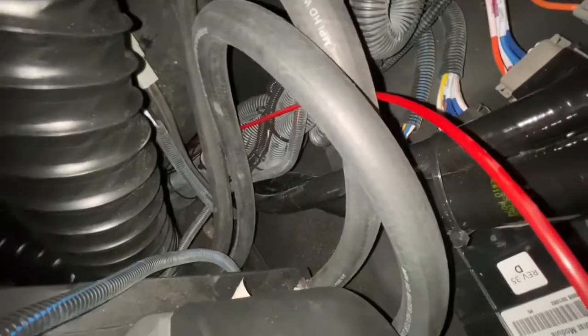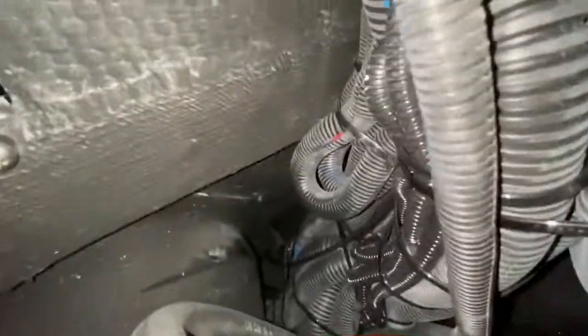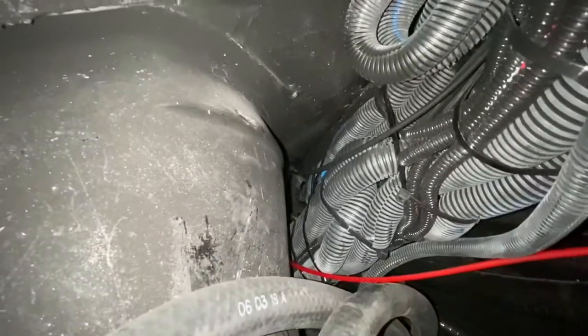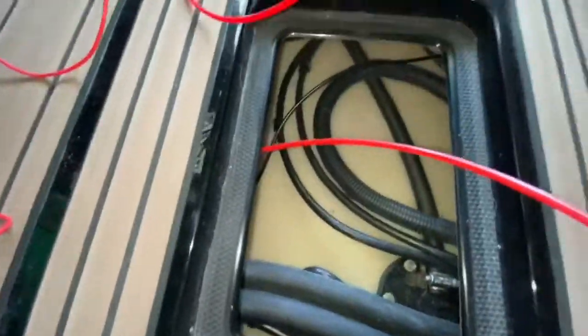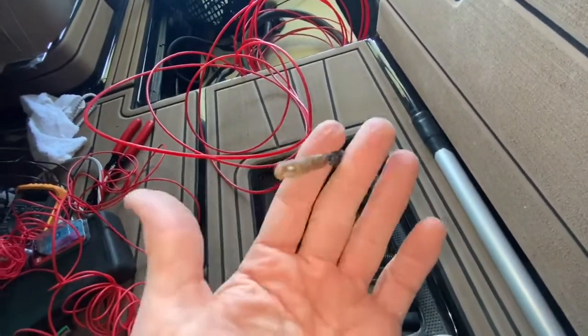Push the fish tape down along all these hoses and wires. If you stick your arm all the way down there, you can kind of feel where the wires go and shove the fish tape through that area — it's not easy but it can be done. I've done it twice; on my last video with the Centurion I put the wiring for the paddle wheel down through there. Push it all the way down, then reach up under here toward this area, feel the fish tape, and pull the end out — there you've got your lead.